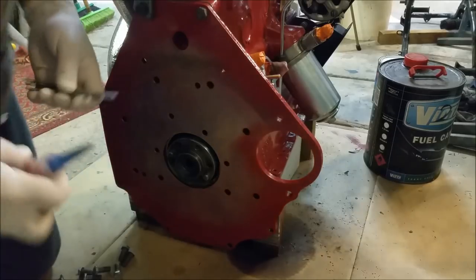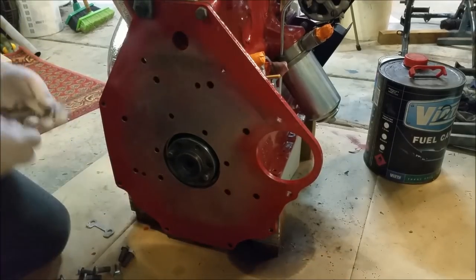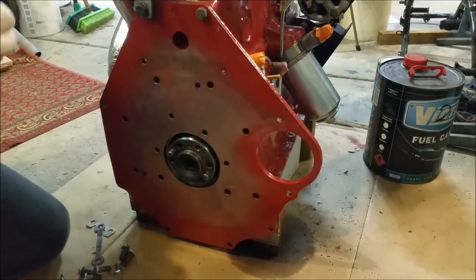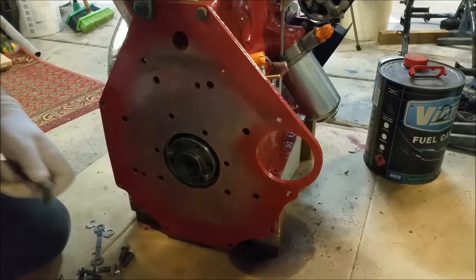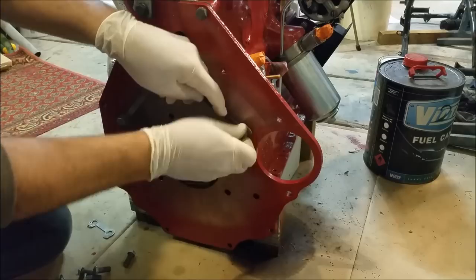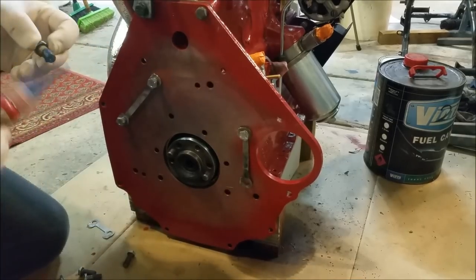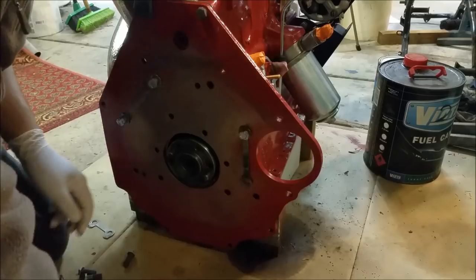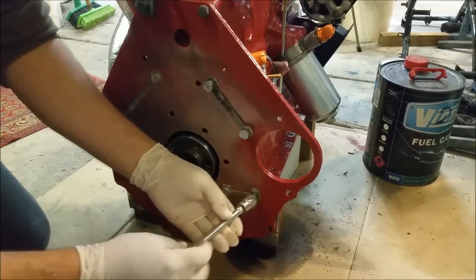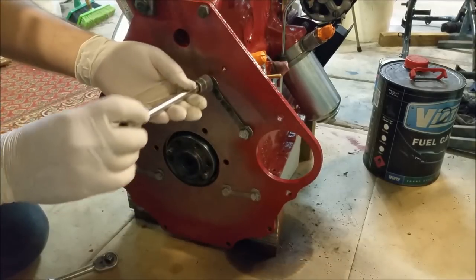This engine used a bunch of straps which have a bending-down effect. I'm not going to bend the tabs over and I haven't ordered new ones, but I'm going to use Loctite - this will be fine. Many people leave these straps off. I've had an accident with the Loctite - too much. I'm just going to snug them down, not be too over-zealous tightening up. I want to just pull it down evenly and then I'll put the rear main in and then the cover, then I'll torque them all up.